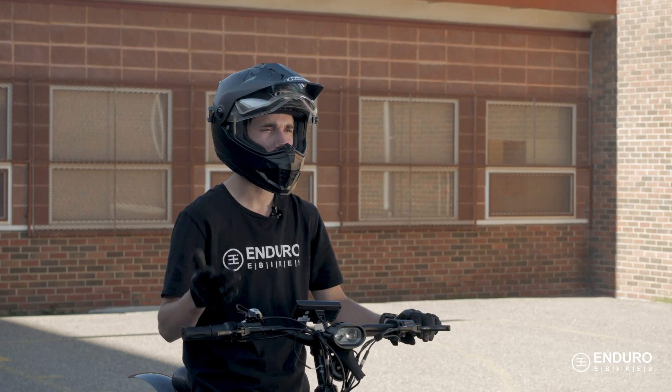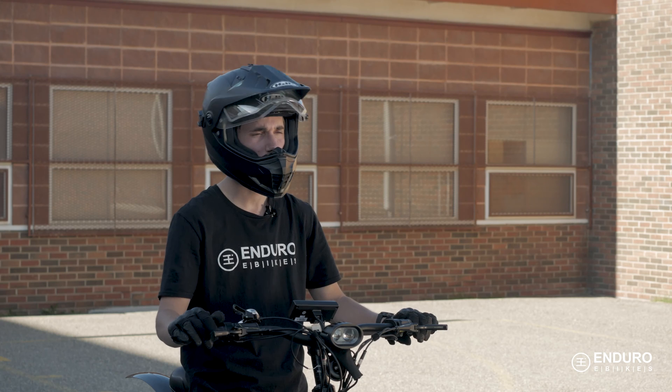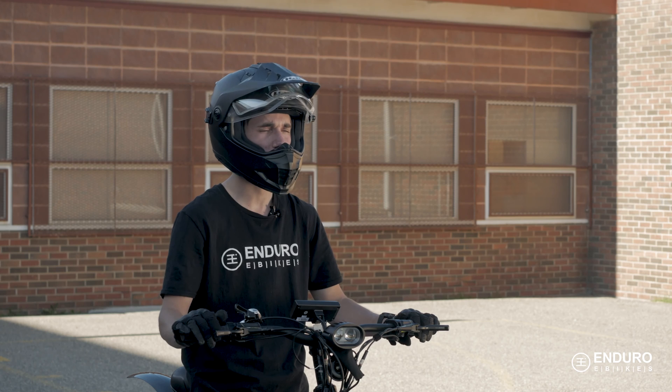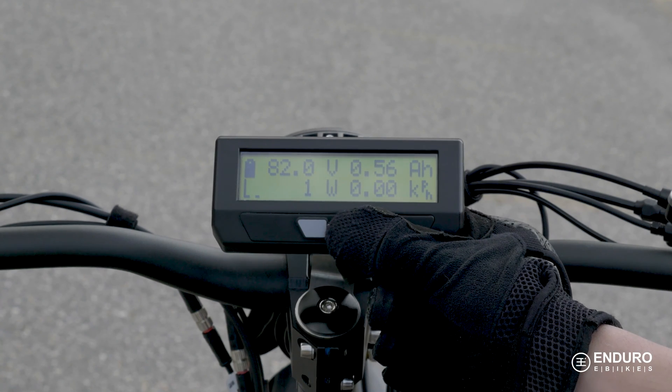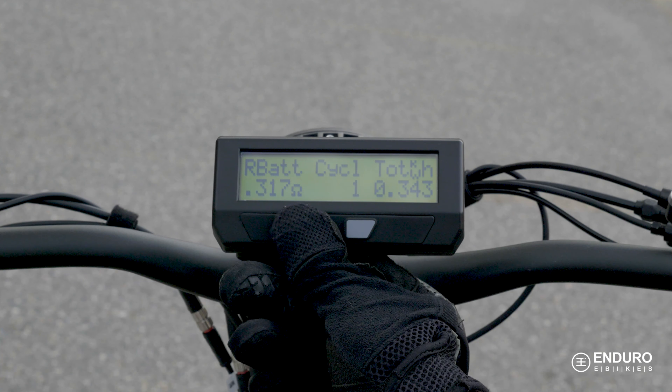The display field can be configured to show other stats like motor temperature or instantaneous watt-hour per kilometer. But a word of advice: you'll generally find the consumed amp hours to be amongst the most useful and important pieces of information on the display. That said, it is only useful if you remember to do a trip reset each time you recharge the battery pack. This can be done by holding down the right button until you see the message 'Reset Trip' pop up on the screen. Press the right button again to select Y for yes, and this will ensure that the battery cycle statistics remain accurate.